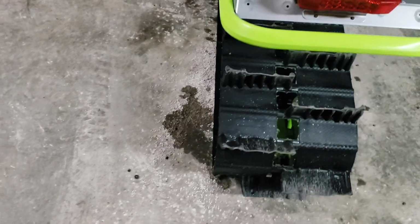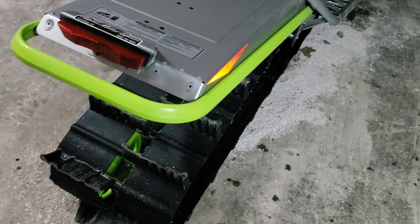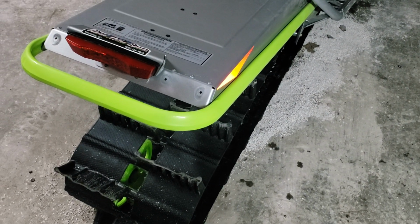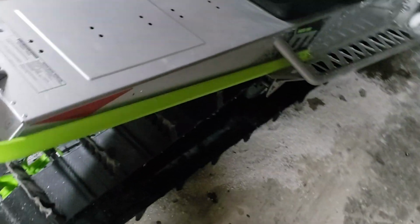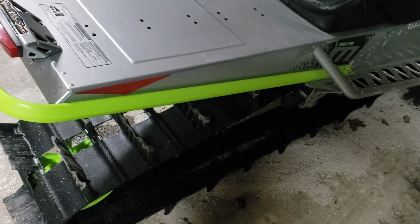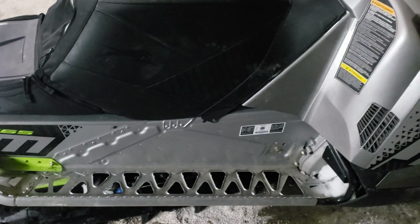By far my biggest complaint would be the snow flaps on all of them. They act like a big anchor. And you won't notice it until you get in the real deep, fresh powder. And then it just starts acting like an anchor when you start turning and getting up on edge. So all of them no longer have flaps on them. All of them have retied knots and the recoils have been fixed.